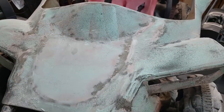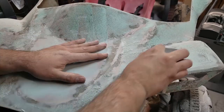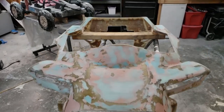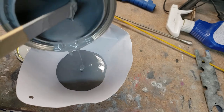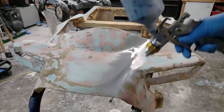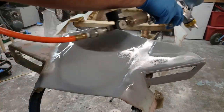There's a lot of sanding — I would guess maybe around five to six hours of pure sanding, so this is a very long project. I got it all wiped down with wax and grease remover before I throw down my primer. I'm using automotive primer — this is a high build two-part primer. This step lets me see any imperfections that I might have missed, and I can always come back after the primer has been laid.